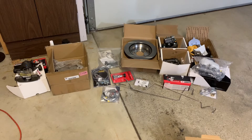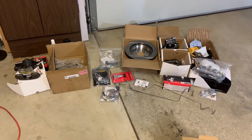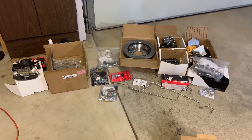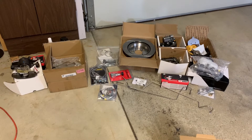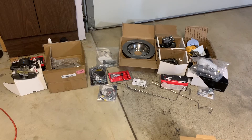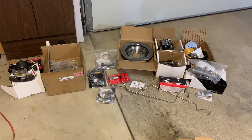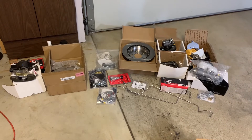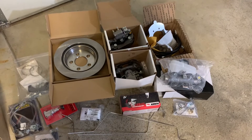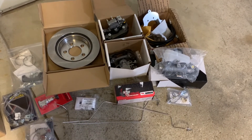After doing a lot of researching on the braking system, being that it is a front mid-engine car and the weight is shifted more towards the rear, these tend to like more rear brake — a much larger rear brake system. Currently, the car has the Fox Body stock disc-drum setup out of the 89 Mustang that was used as the donor vehicle. Here is basically the pile of parts I have for the rear of this vehicle.